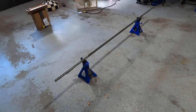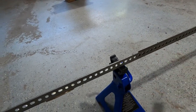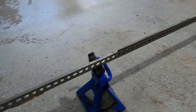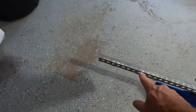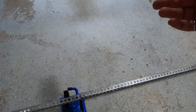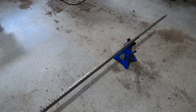I thought I'd insert a short video just to show what I meant. Having two sets of regular angle iron — the type you'd use for mounting a garage door opener — bolted together with marked locations, and then setting up a string through eye bolts at those locations and duplicating the other side, makes it much faster to create a square string box. You're going to have these set exactly the same way with the same reference point for putting the string from one side to the other. This ensures the two strings are parallel. You'd have one set mounted on either end of the car and run the strings between — that sets up your reference box.